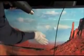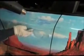Great care is required when dealing with preparation of the bottom part of the sill, as it's exposed to particularly heavy soiling, such as street dirt, or tar or de-icing salt deposits. The recessed grips are heated slightly and the vinyl smoothed into them by hand. This difficult operation may also be performed with a calendared ORACAL vinyl.